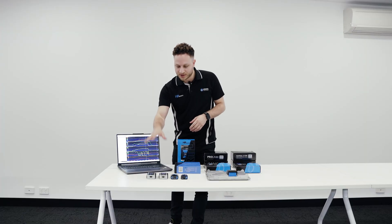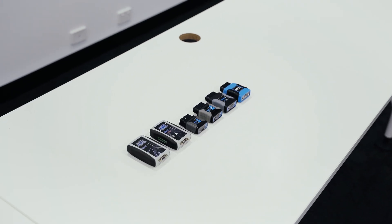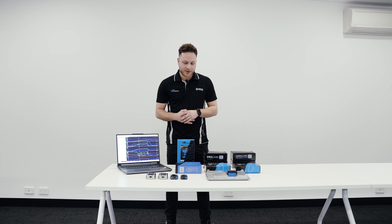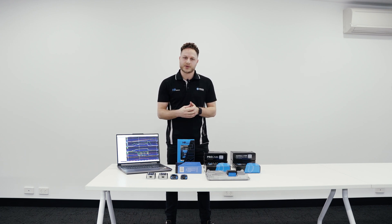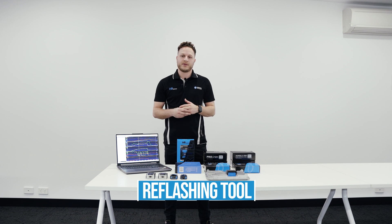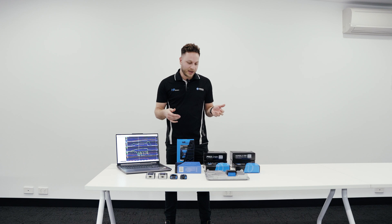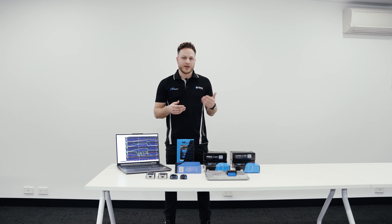As you can see in front of me, these are some of the older units — MPVI 1, MPVI 2 and 2 Plus — and the current flagship model which is the MPVI 3. One thing you're probably wondering is how HP Tuners differs from other tuning softwares, whether it be MoTeC, Haltech, FuelTech or any of those aftermarket brands. HP Tuners, for most of its history, is predominantly a reflashing program — it is re-tuning the factory ECU. It is not a standalone ECU for now. It is not a piggyback system.